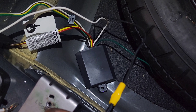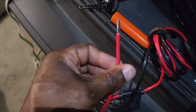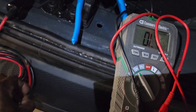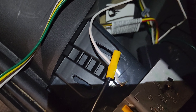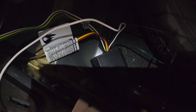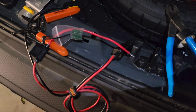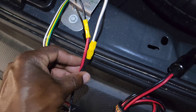I'm going to do black to white and red to black - I verified that with my voltmeter continuity test. So do black to white and red to black. If you buy this exact same one, I'm going to put both in the description: the power adapter as well as the trailer light harness.